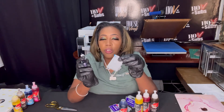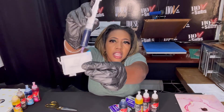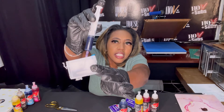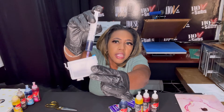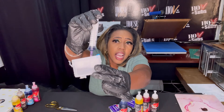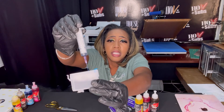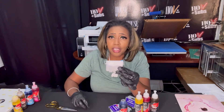I'm going to hold this at an angle and place my syringe inside, and I'm just going to fill it up slowly with ink. That ain't bad, y'all — it's easy peasy. I'm pushing the ink in. What I'm going to do is show y'all a technique because I like to purge and prime my cartridges twice. I know it may be overkill, but it's going to save you a lot of cleaning times if you do this.